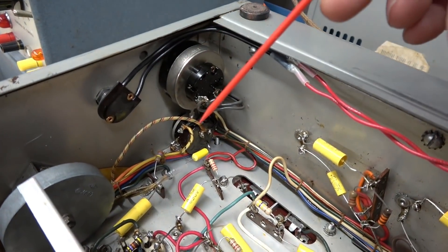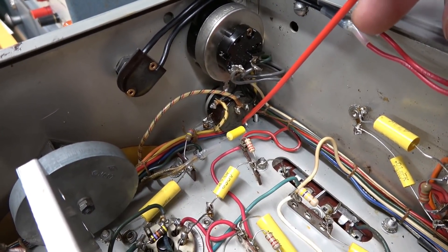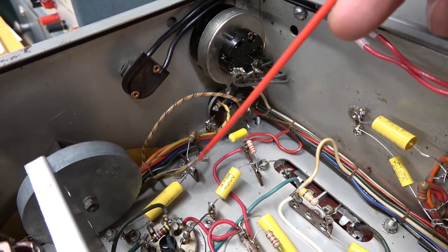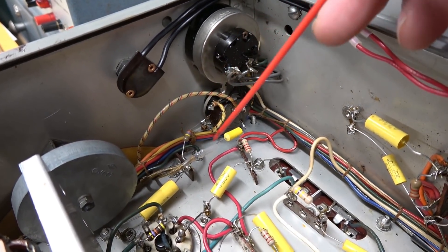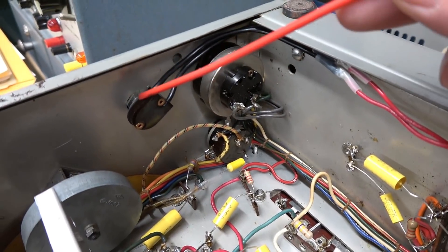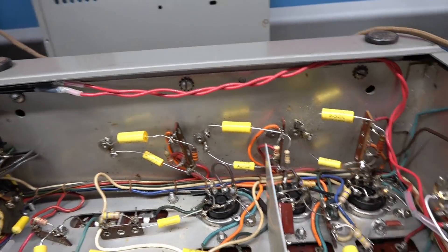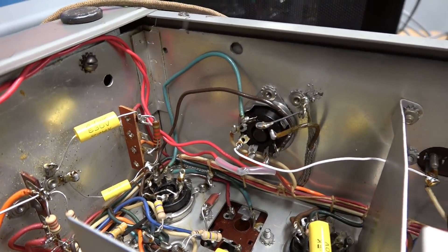You remove that, and then the 0.01 capacitor coming off of this control that normally went to the jack — back down to these two wires — you're going to remove the jack and simply splice those two together, putting some heat shrink on there to stop it from shorting out. The new switch wires extend and wrap around the radio back to that octo plug.